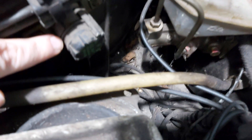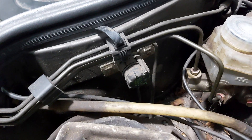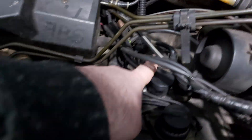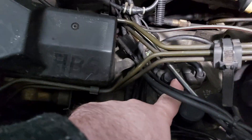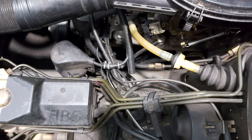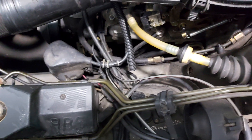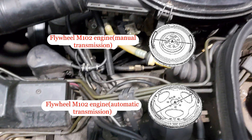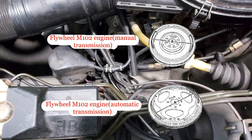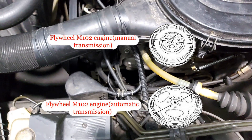The only way to adjust the timing is on this resistor trimming plug, located here. Any other adjustment is not possible because the electronic ignition EZL handles that job. As you crank the engine and it starts operating, the timing is set by two notches on the flywheel, 180 degrees opposed against each other, which determine whether ignition is going to be late or early.